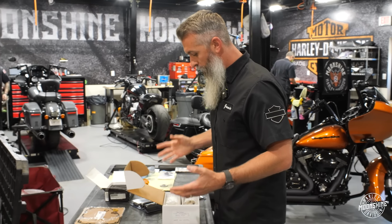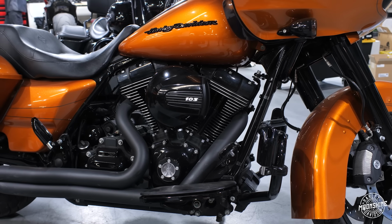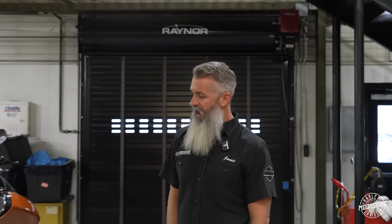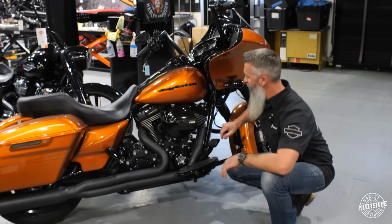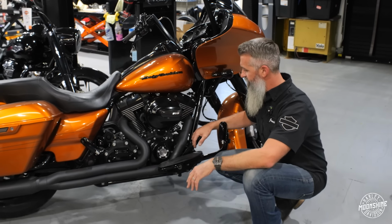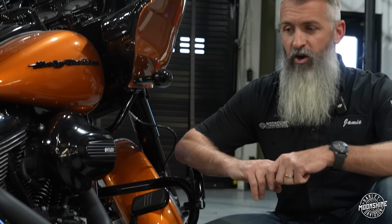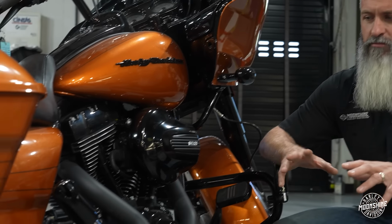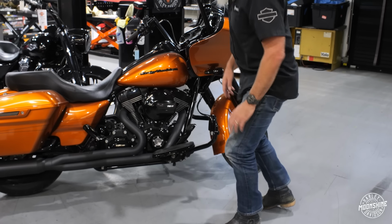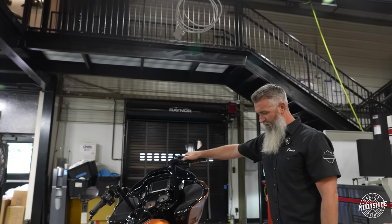We'll go over the build, the parts in it, but first the bike's behind me. We have a 2016 Road Glide, Amber Whiskey, great build. Customer's already blacked it out. All right, customer already got the stage 1 air cleaner done from Harley. He's got a full exhaust system on this. So this is the Twin Cam D&D Fat Cat 2-in-1. Great sounding pipe, great performing bike, made in Texas, America all the way, and customer wants a little bit more power now. We'll hear what she sounds like before the cam build.